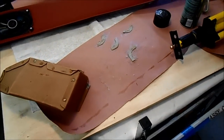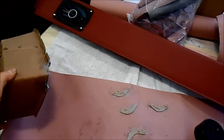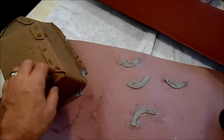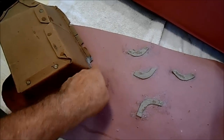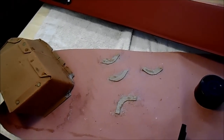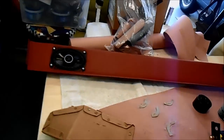I'm working on the glove box. I'm going to reflock it, but before I reflock it I need to repair this little corner that tore off. I have some thin cardboard and I'm going to glue multiple layers into this corner. I'll make the first one longer than it needs to be so it'll attach to the sides and give it a little structure. I sprayed some adhesive on those and I'm waiting for that to set up.